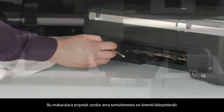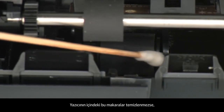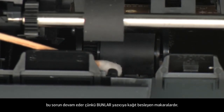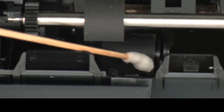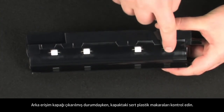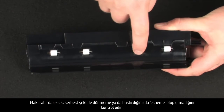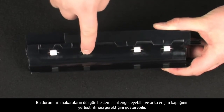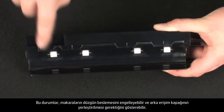These rollers are difficult to reach, but they are the most important to clean. If these rollers inside the printer are not cleaned, this problem will continue because these are the rollers that feed paper into the printer. While the rear access door is off, check the hard plastic rollers on the door. Note if any rollers are missing, don't roll freely, or are not springy when you push on them — these conditions could prevent the rollers from feeding properly and mean the rear access door needs to be replaced.